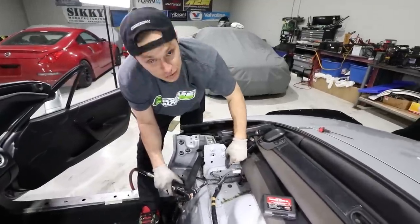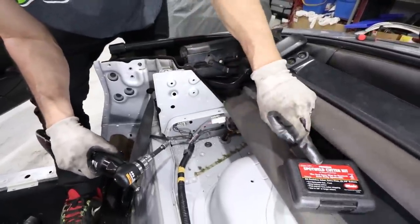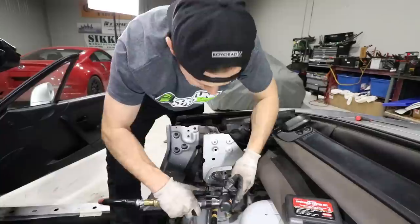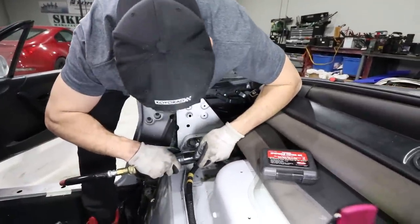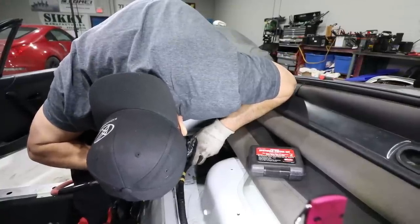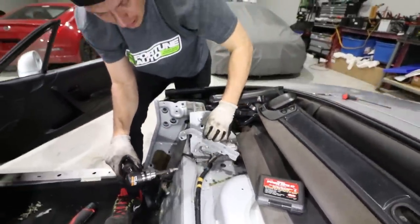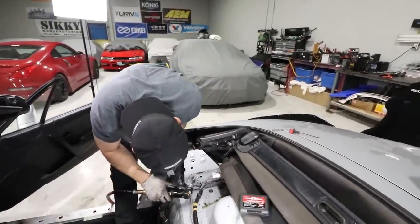We are on to modifying the chassis here to fit up that roll bar. The first thing we need to do is remove this little lip here. I've busted out the spot weld cutter kit. We could have just cut this off, however this is a much cleaner and nicer way of removing pieces of metal that have been spot welded on. Look at that — came off nice and clean. I didn't drill through the metal on the other side, which is good.